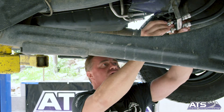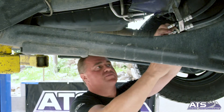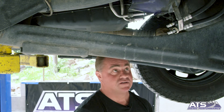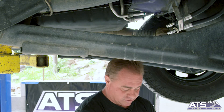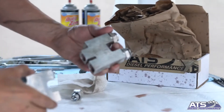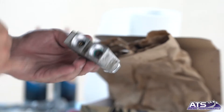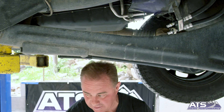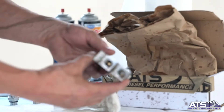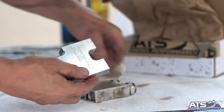There was some comment about the leak and this is your crimp-on connection — just an o-ring seal on both ends. Make sure there's no scarring on them; typically you won't see scarring, but if you do, the o-ring is not going to seal. Here's our block that came out, and you'll see the piece inside that creates the bypassing issues — it just sticks. No surprise, because the converter takes all the abuse, drops material, it goes right into this valve, sticks it, and then you're going to overheat. Really low mileage — just a bad design.